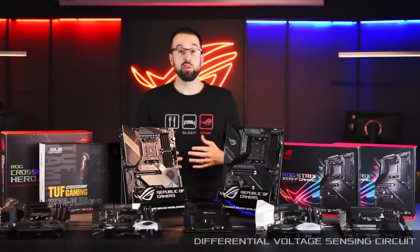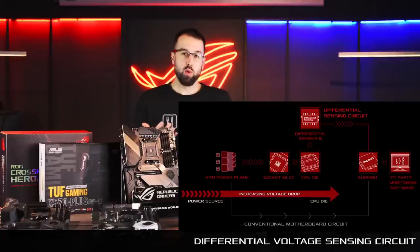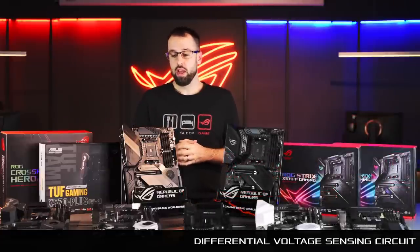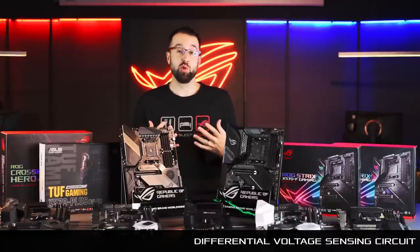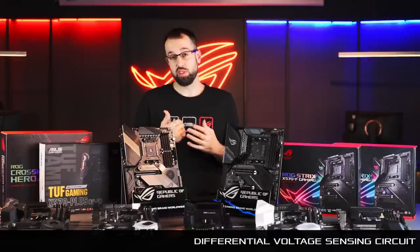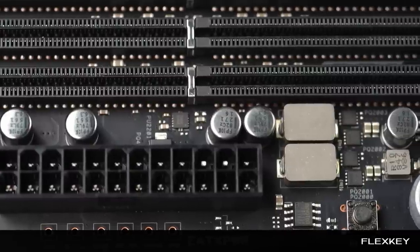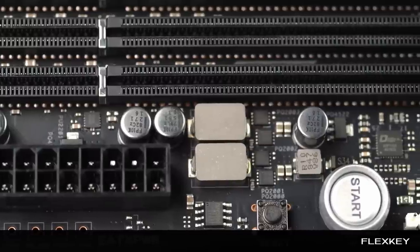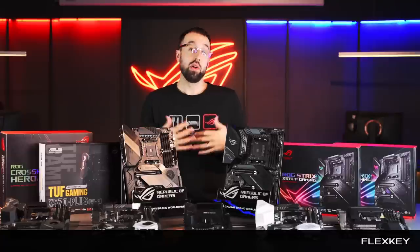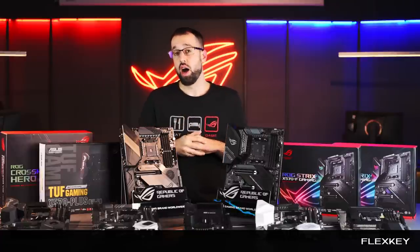With Ryzen 3000 CPUs, you have a lot of flexibility in the memory space. Optimem 3 allows you to tweak for extremely high frequencies if you're trying to break records, or dial in really tight timings at the performance sweet spot of DDR4-3400. We also have a differential voltage sensing circuit, which is really helpful when tuning performance. Normally voltage measurements from the CPU aren't quite accurate since the measurement takes place outside the CPU. This circuit lets you get that reading directly from the CPU, making the overclocking experience much more intuitive and precise. All X570 Crosshair boards also come with FlexKey, allowing you to remap the reset button to another convenient function — like going directly to BIOS or turning off the lights. Exclusively with Crosshair boards, you can also go directly into Safeboot with the reset button.